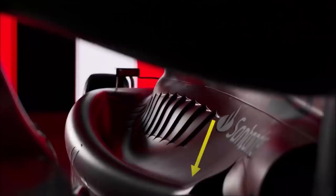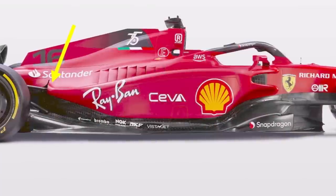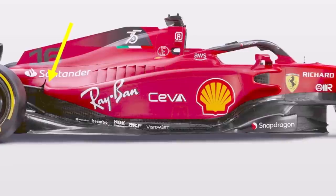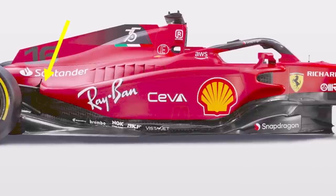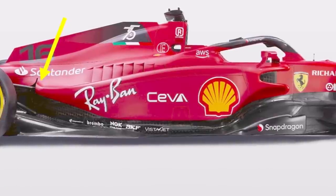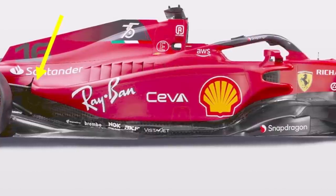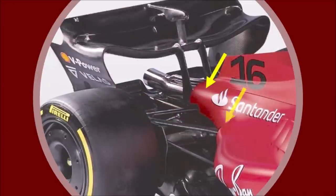While everybody else needs to pull air to the center to reach the rear, Ferrari has bodywork on the outside and can push air towards the center, similar to a bobsled track. What's interesting is that the bodywork is rising again, creating a sidepod with a dip, which could create a little pond either side when the car is standing in the rain. At the end of the sidepod is an opening for the upper wishbone mounting — it has a kick upwards because of the wishbone movement, but this opening points to the back and is larger than what you would usually need for a suspension mounting. This acts as an additional air outlet, and the significantly larger sidepod inlet could blow air towards here. However, because of the direction and the fact that there is a wishbone in the way, I cannot see how Ferrari would take advantage from blowing additional air through that. But this additional outlet enables them to have a smaller exit at the back, which gives more space for the beamwing flow.